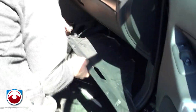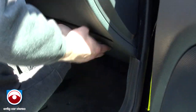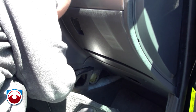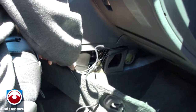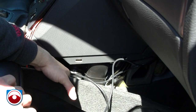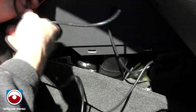Go back in front. Pretty much you just grab the cable over here — there's a little hook in the back in the middle where it dips that you have to make sure it slides in. Then just pop it in this way and put the two screws back in. The wires can be run right here — just tuck them out of the way. Unlike how-to's you see out there, I mount the brain over here. I disconnect these cables and mount it over here, out of the way. If a customer ever needs to get to it, they can get to it without coming in here. If they have any problems, they can take it out, mail it — whatever they want. Then run the fiber optic cables — these two cables plug in right there. Let's go to the other side and show you power.